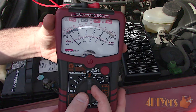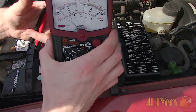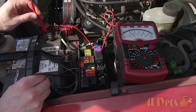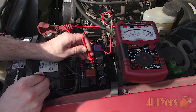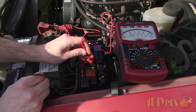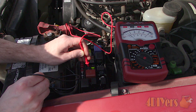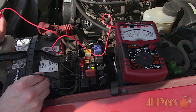For the analog meter, it's very similar to the digital version, however it doesn't require batteries to test for voltage. With the system being 12 volts, it'll need to be set to the 50-volt max setting, as the 10-volt setting will max out on the needle sweep. Same as before, use a sufficient ground source and test the meter first. Then continue to test each of the fuses with the vehicle's electrical system on. When power is present, you'll see the needle sweep and both sides of the fuse will have a reading if the fuse is good. If there's only power on one side of the fuse and not the other, the fuse is faulty.